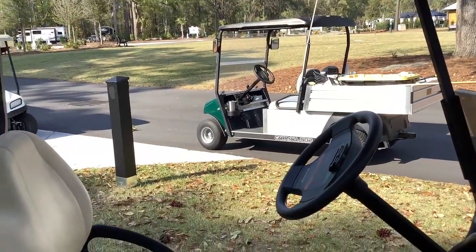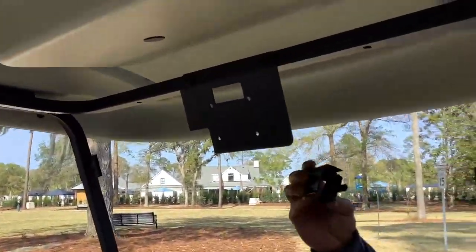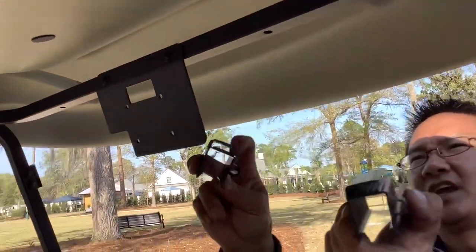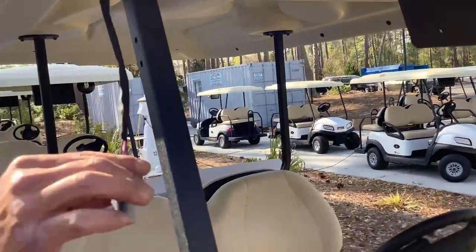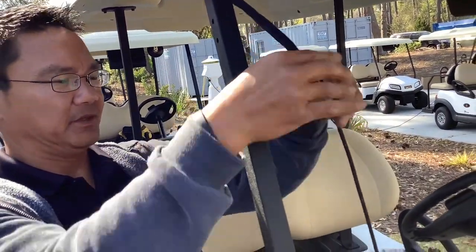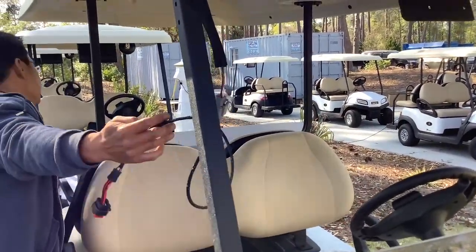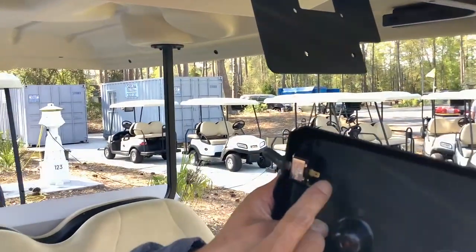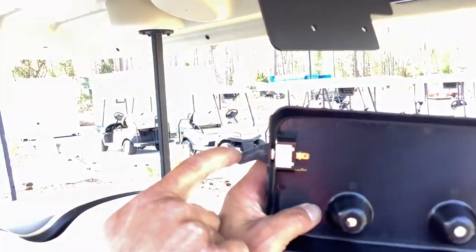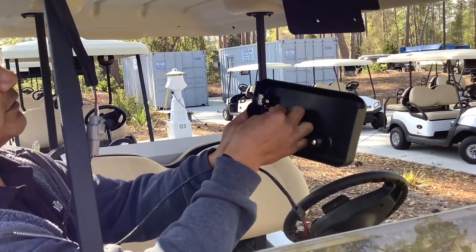Next we can work on the cabling to the VDU. We have our clamps — these are the two guides with holes to hold the cable. Put those towards the front so the driver and passengers don't see the cabling. Connect the harness to the top of the strut first, then include the adapter for the VDU and the connection to the toggle switch on the back cover. When installing the toggle switch, make sure the bottom spade is towards the bottom — that makes up equal on and down equal off. If you put them in upside down, down will be on and up will be off.